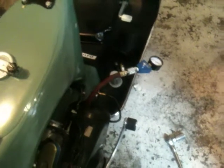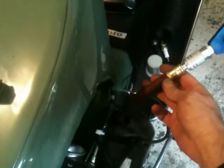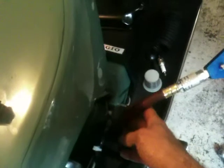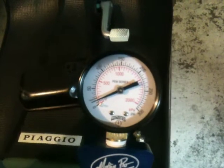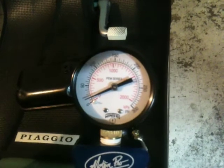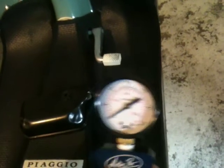This is your bike's engine. I have a Motion Pro compression tester already bolted in place — it screws into where your spark plug goes. You'll see that on this gauge it goes to 300; the section in the middle is at 150. So I'm going to bleed all the pressure out of it.